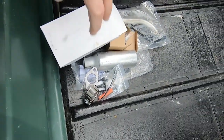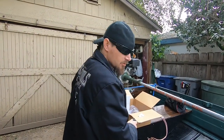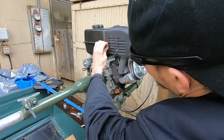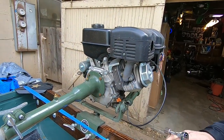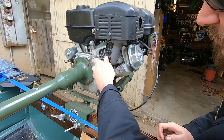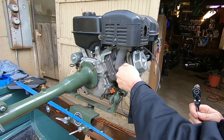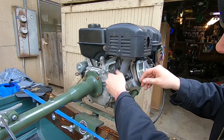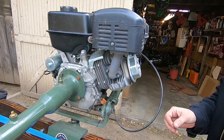Alright, so we got a whole bunch of parts here. Let's get over to the engine and hopefully get a couple more horsepower out of this thing. We're going to take a look at this exhaust pipe first, because I might have to go get some bolts. Here's my throttle spring — we're going to pop this thing off. These are 13s, all we got to do is loosen these babies up. Maybe if I loosen it up I can get it off.